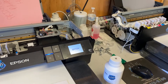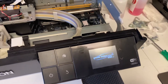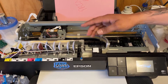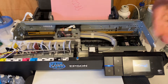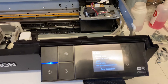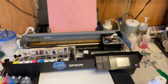We have a set of instructions for how we do this every day. The first step is turning it on — you may see error 51 because I turned it too long. It'll only be a few seconds. As you can see, the printer is turning on. This button here is for the ink cartridges — when it says ink needs to be replaced, press the button and it tells the printer the ink cartridges are back in. Error 51 is very common; it's just the capping station. Turn it off, turn it back on, and you're set to go.